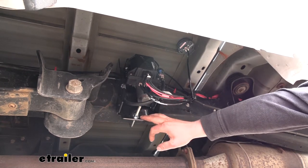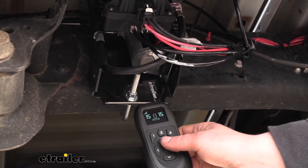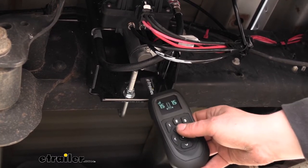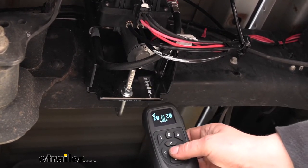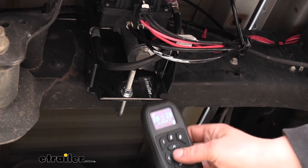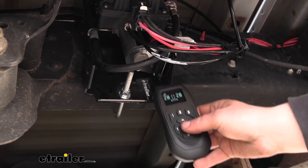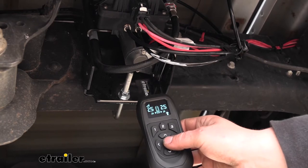This bracket even comes with a U-bolt, so you don't even have to drill in some cases. I have personally dealt with a handful of different types of wireless compressor systems, and honestly this one impresses me the most for a few different reasons: how responsive it is, how quiet the compressor is, and how fast it fills the bags up. We'll go ahead and fill it up to 20 psi — just a few seconds and the compressor is going to kick on, compared to some other style ones where it's really delayed. You might have to wait 30 seconds or a minute and be unsure if it's even working. It's really loud and so on. But this one — you can see it put 5 psi in the bags relatively quick.